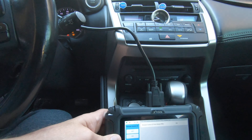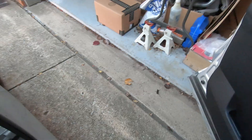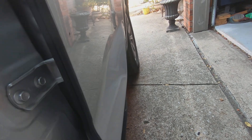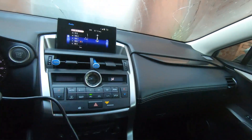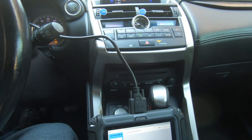And just to make sure that you can hear them go back the other way — so right now they're retracted to where you could put brake pads on your vehicle. I'm going to put the camera out here, hit the off button, and we're going to reset them. And there you go. So as you can see, if you had to put brakes on this car — rear pads — you would have been able to do it.